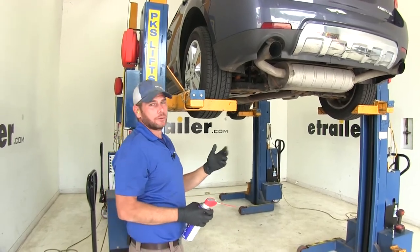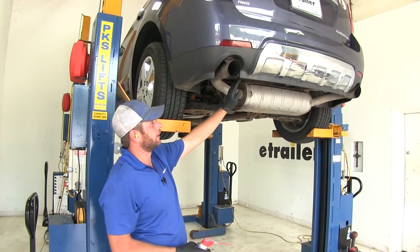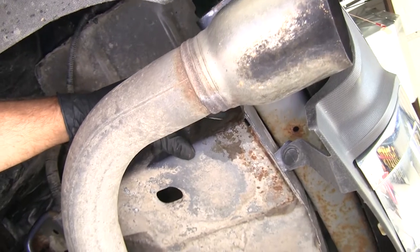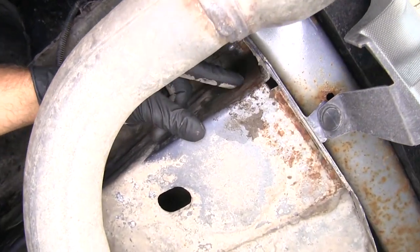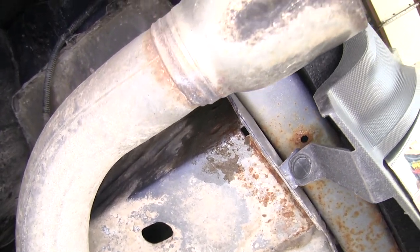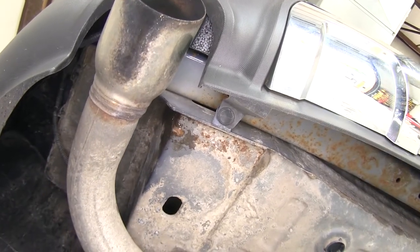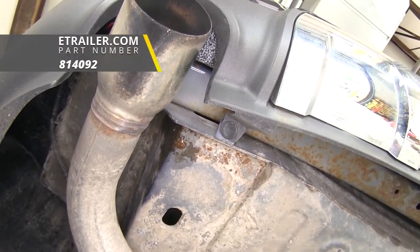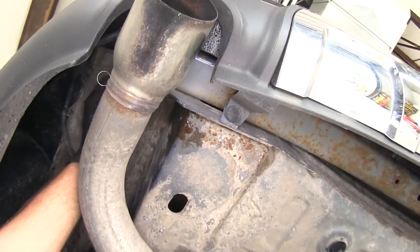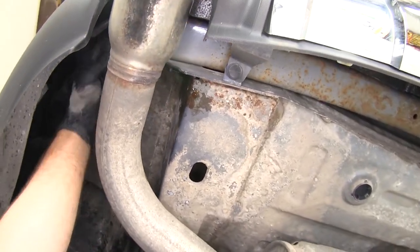To get our hitch put in place we're going to be using two weld nuts on the outside of the frame rail — they're going to be in the same spot on both sides. There's also a push pin fastener located right down here and one just directly above it. You want to use a little bit of spray lubricant and then a nylon tube brush — we're using part number 814092 — to get all the debris, rust, and things like that out of those weld nuts so our bolts will actually go in.